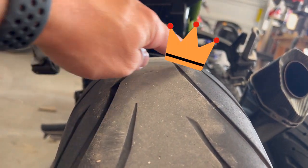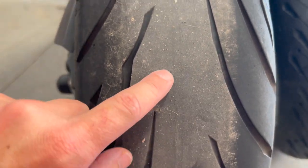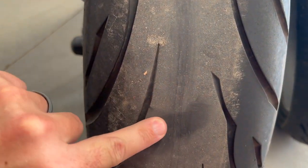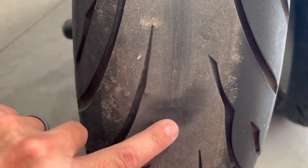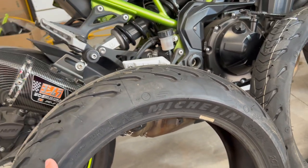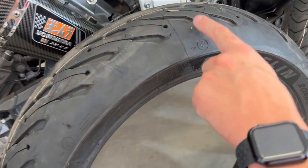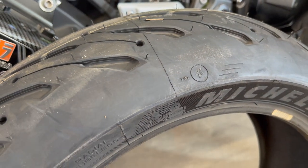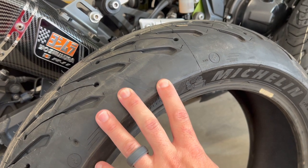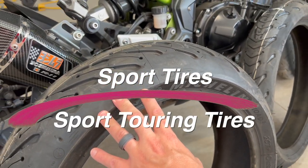When we said we flattened out the crown of our rear tire, this is what we're talking about — it looks like we gave the tire a little flat top. We're also beginning to see where the rubber meets the steel belt, which is a bad sign, so obviously this tire needs changed. The front tire is in a similar condition and is due for a change. We decided to go with Michelin Road 5s because of good reviews on their longevity and water-wicking ability. You can see some deep grooves that help in wet conditions. Since I ride a lot, I went with sport touring tires rather than sport tires.